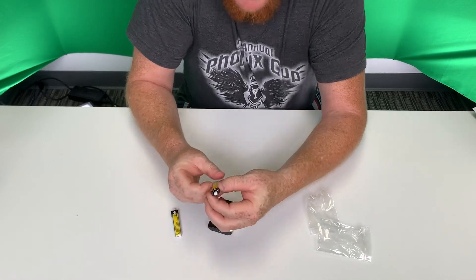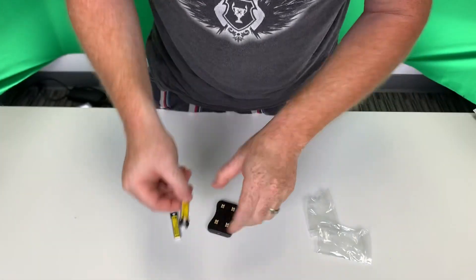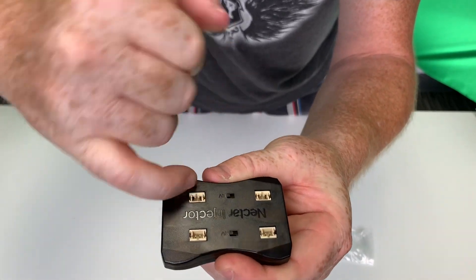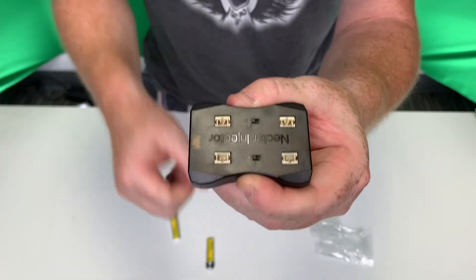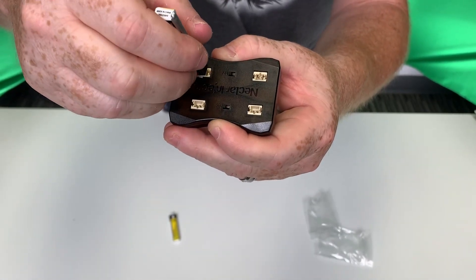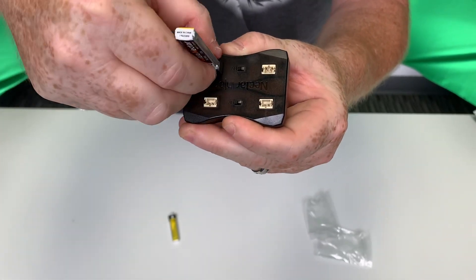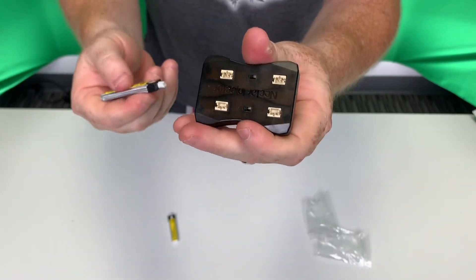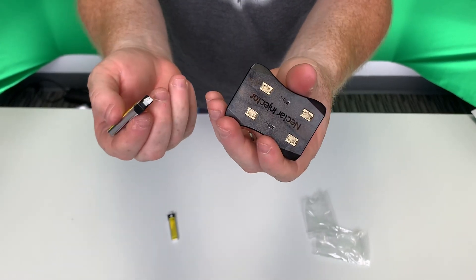You can see there are these two little hooks right here. What happens is they get stuck inside the charger — there are little holes in the bottom. When you put the battery in, the hooks get stuck, and when you try to pull straight up they just won't come out. So you have to disengage them by pushing it down a little bit, tilting it in, and then pulling it out. It's not super smooth but it will work, and that's how you take it out safely without breaking them.